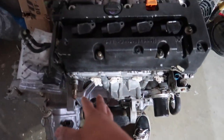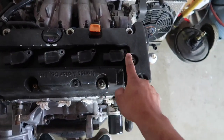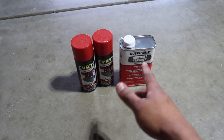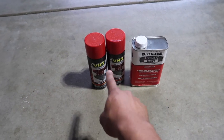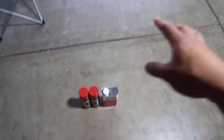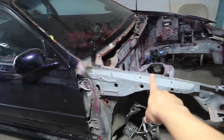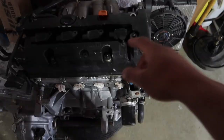Back in the garage, same day as the last video, just making more content. Today we're going to remove this valve cover — take off these six bolts, get it cleaned up, degrease it. We have some aircraft remover from Rust-Oleum here, and our VHT wrinkle plus red paint. That's the color we chose for the valve cover to match the wheels on the hatch. Let us know in the comments if you have any suggestions for the engine bay color.